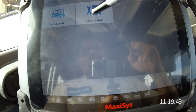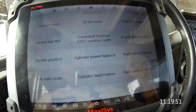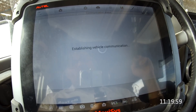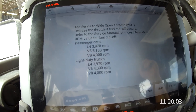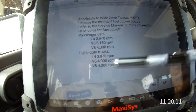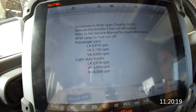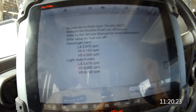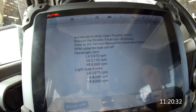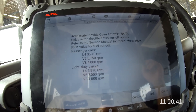Let's go into Diagnosis, Control Unit, Engine Control Module, Special Functions — that menu is pretty much the same in most scanners. Crankshaft Variation Learn right here; some call it a case learn. What it's telling us is we're going to floor it and the engine RPM should cut out at a specific RPM — on a passenger truck, about 4,000 RPM. If the engine continues to rev past 4,000 RPM, let off, something went wrong. There are several constraints like coolant temperature, being in park, brake on, or the crank variation will not learn. One of the inhibitors is having active engine codes — so if you have any engine codes like for a camshaft position sensor, you're not going to be able to set your crank variation.